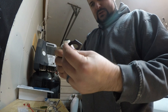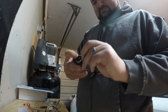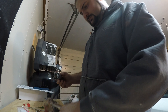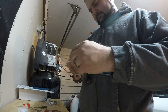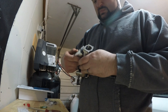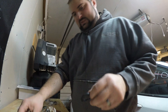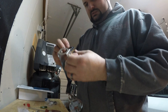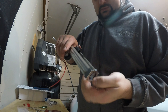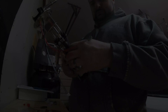Let's check our instructions. So this is the fuel pump isolator, and it needs to go on the fuel pump like this. It has a little notch on the bottom — we want that to go down. Now we've got to figure out how the fuel pump goes in here — I might have to loosen up these Phillips head screws at the top.